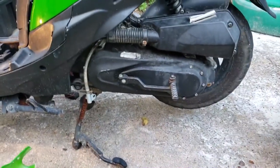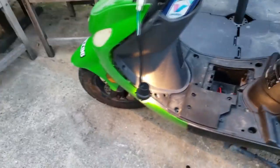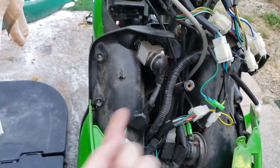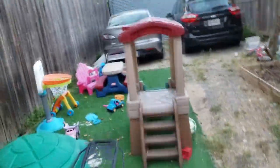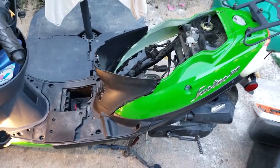At this point I've got the lights working except for the brights — turning brights on doesn't work but the light itself works. All the turn signals work now. I just need to run a new ground wire, cut out the damaged green wire, run a new one into the wiring harness down to where it was all destroyed, connect it back to where the ground actually connects, replace all those green wires, put it all back together, and give it a test drive on the road.